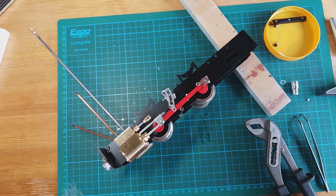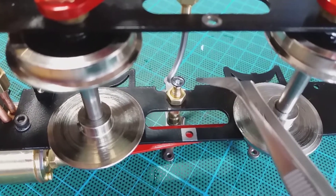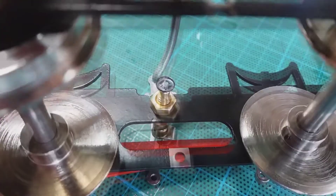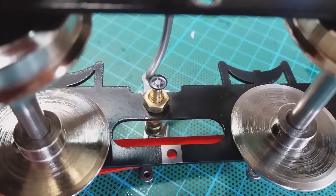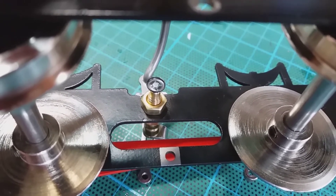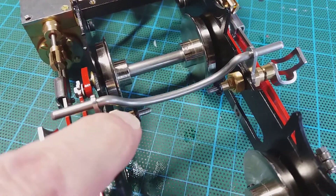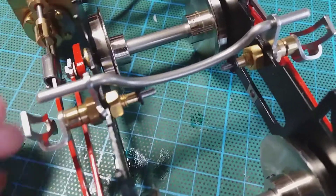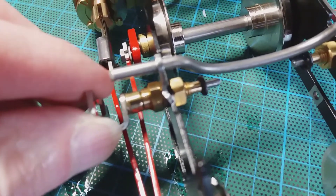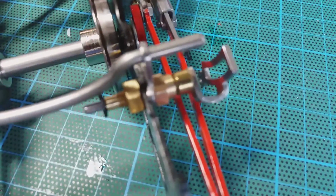I'll bring the camera down so you can see it — it's just on the end there, just managed to get across the end of the pivot pin. Then it's a case of just pushing it down using pliers and maybe giving it a little tap, pushing it all the way down. The expansion link shouldn't be tight. You can see the star lock washers are in and there's just the minimum of actual movement.